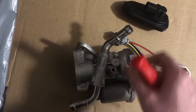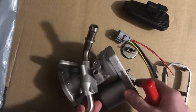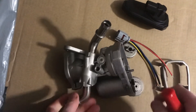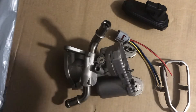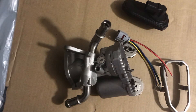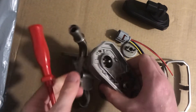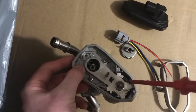You can blank them with plates that you put across these ports, but that usually throws up an engine management warning again, which means you have to drill holes through them — which sort of defeats the point of an EGR blank, really.